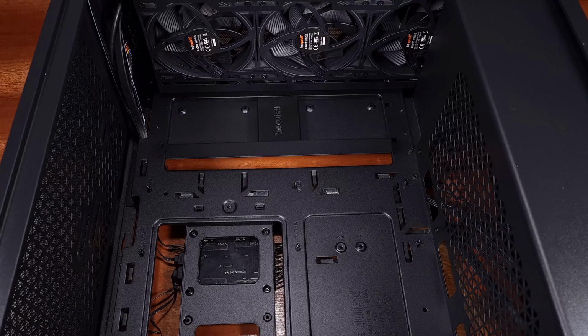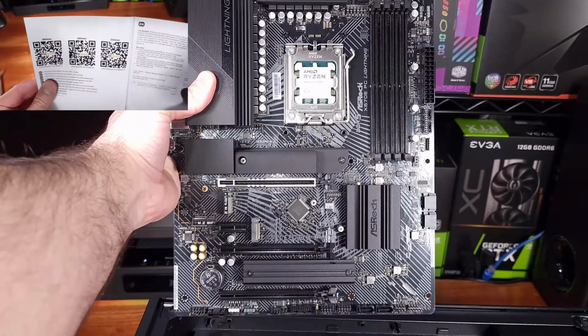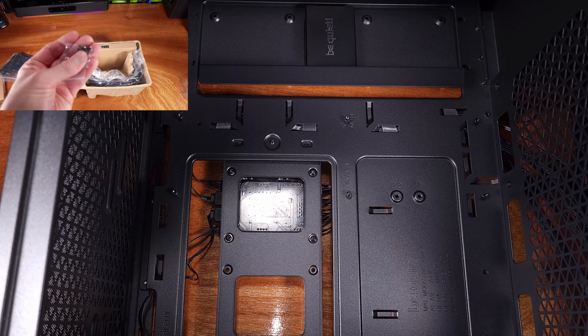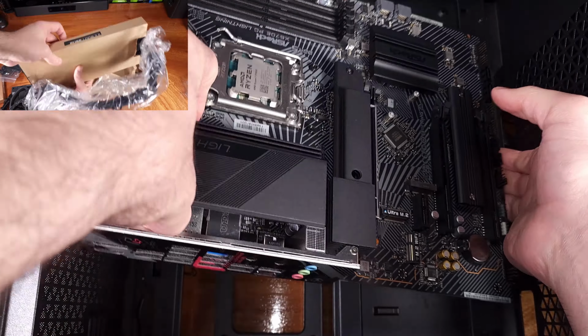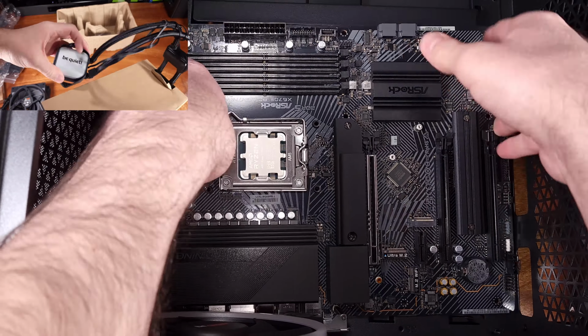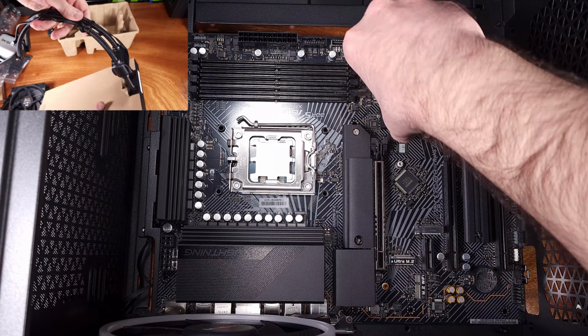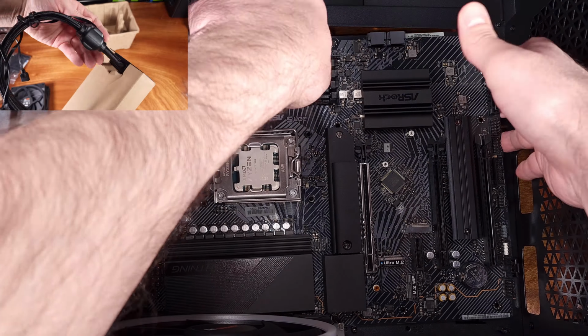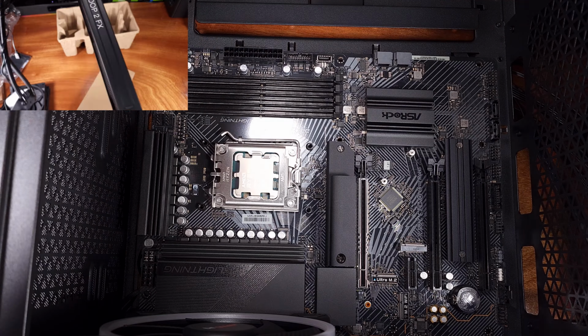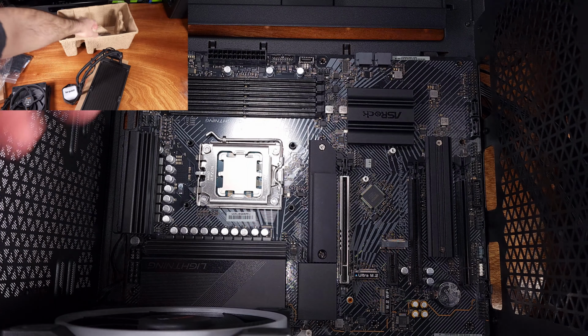Each of the temperature tests took place over the course of an hour to get a good average. All testing was done in a 20 degrees C ambient environment. The Ryzen 7 7700X is known to run hot, so for the thermal testing, I ran the fans both at a 70% fan speed and then again at a 100% fan speed to see what a decent paced but low noise option would give me, and then all out.